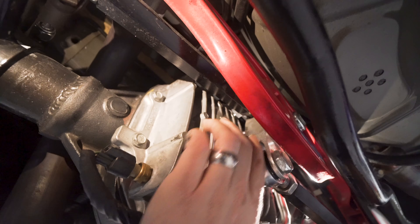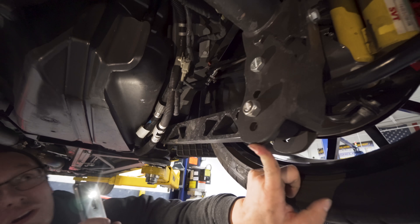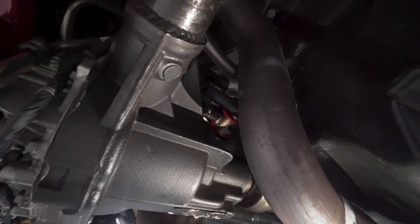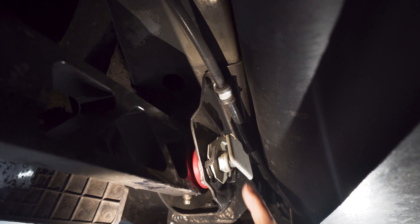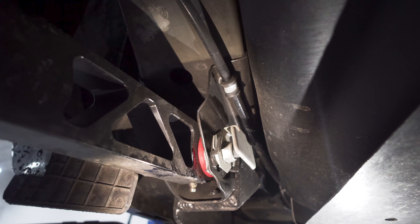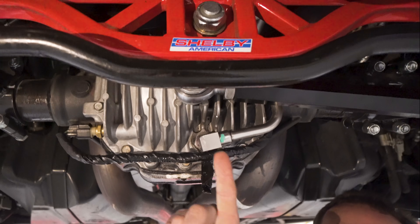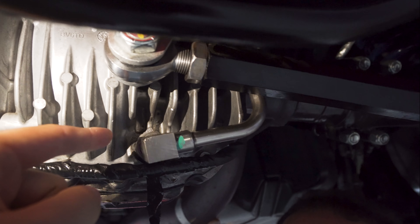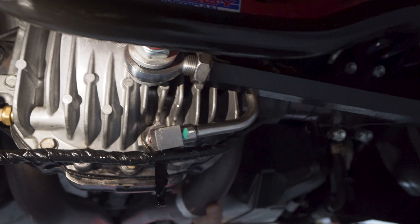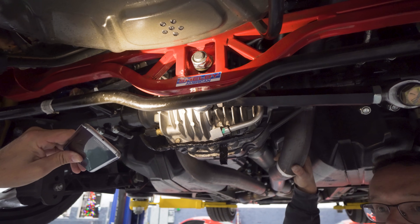These are the spacers for the watts link. For the control arm bushings, we've got one, two, three, four, and then one on either end of the upper control arm — six bushings total. The only one that looks questionable is this one, but it's hard to tell until you actually take it apart. We're going to get a new cover, inspect everything — if the lines are still good we'll reuse them. It looks like we just broke the housing, which is aluminum. If the lines themselves are bad, we'll replace those too. We'll pop the cover off and take a look at the pattern to make sure there are no issues in the rear end.